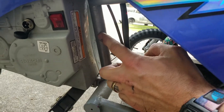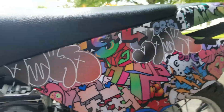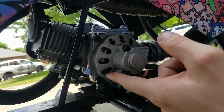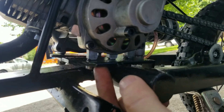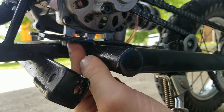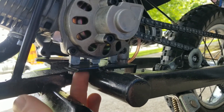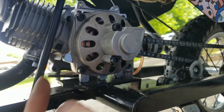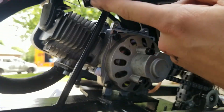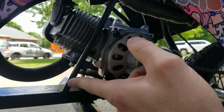In the bike there's a support right in the middle and you have to cut it out — there's no way around that. You cut it out to get an open area, fit the engine in, and mount little pieces of flat bar to the bottom of the engine. Then you set it where it needs to be, tack weld it, take it back off, finish welding everything, and put the motor on later. I also ran a half-inch steel rod right in the center for support.